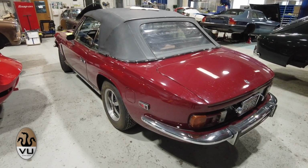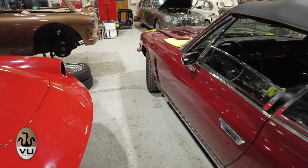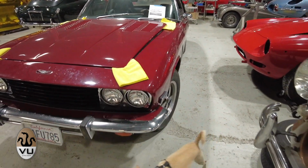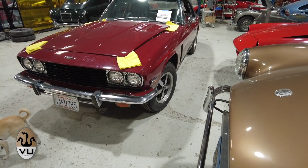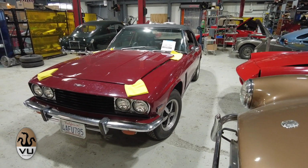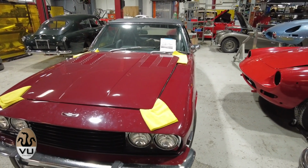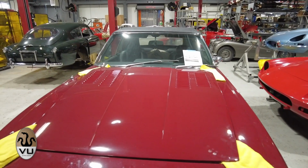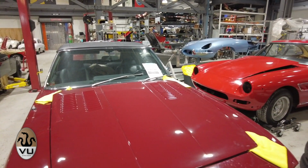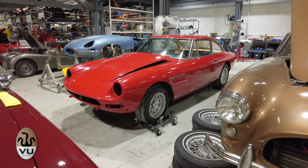I don't know why, but this one is out of the California Bay Area. We're doing a bunch of mechanical, a full engine build, and a bunch of other work to make it stable. Decent car. It just wants to be a little bit more stable, with a little bit more power. The engine in these things is a 440, but, well, that's not true that it's an awful motor. The way they were set up, they had small valves, and they made very little horsepower for being such a giant motor. They got 6 miles a gallon and 170 horse. They were just horrific. Anyway, we can improve that a lot.